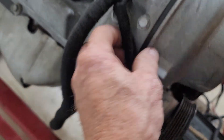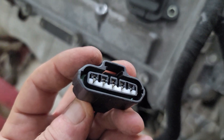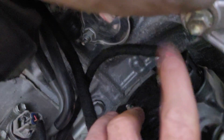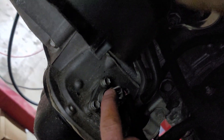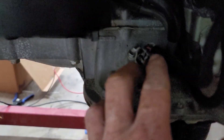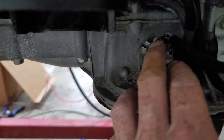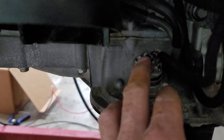It comes down here and splits off. That goes to a 5-pin connector for your airflow meter — we'll plug that in in a moment. It runs down and goes into the back of your alternator. It plugs into this, which is probably not going to be used on your build. If you've changed your sump or whatever, it's a low oil connector — it doesn't actually apply. I should have told the guys to remove that for you, but it's not going to make any difference.